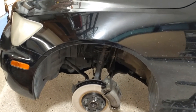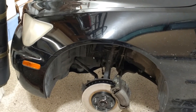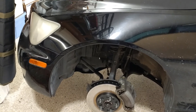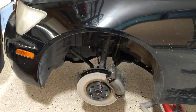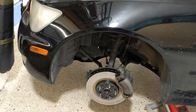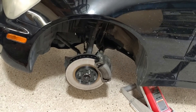One last thing — to be clear, this does not change the fluid in the ABS anti-lock braking system module, which holds a very small amount of fluid. But there's a trick: if you can get your car to a safe place where you can lock up the ABS so it activates front, rear, and all corners, that pushes the nice new fluid you just put in through the ABS module. That would probably be a good thing to do. They have tools at a dealer to open, close, and activate the ABS module, but then you're into a few hundred bucks.